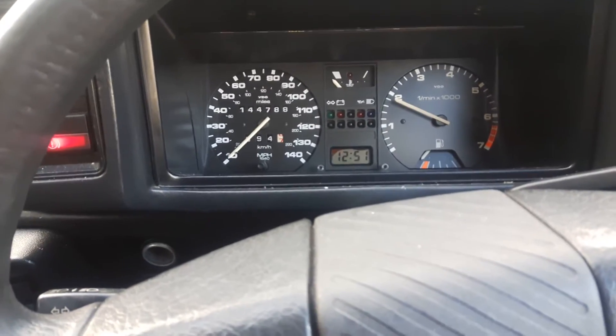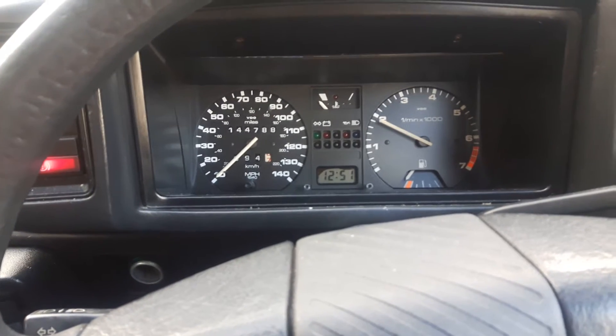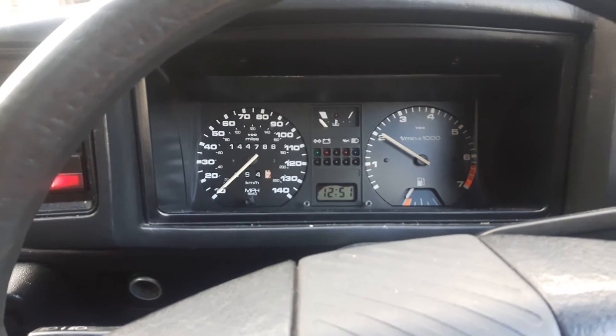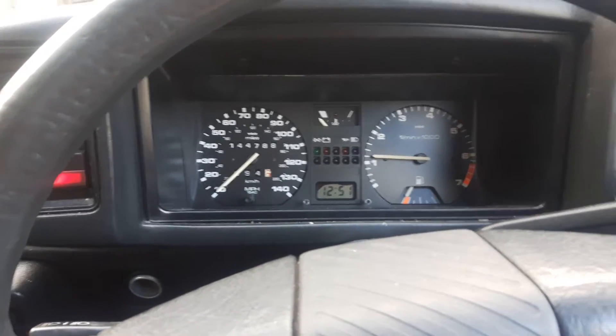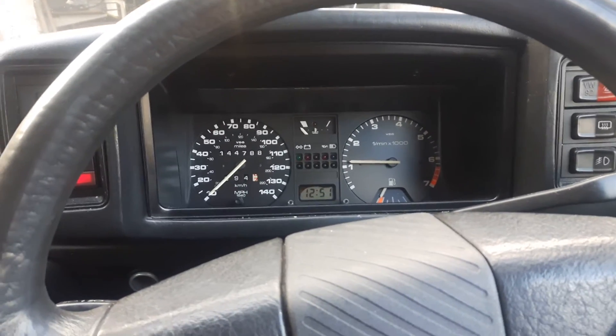There we go — she'll pick up in a minute as the drag decreases in the oil, up to about 2,000 RPM. Now she should drop down depending on how cold it is. There you go — you've got your defined drop to 1,200 RPM. That's how they should work, and then after that point it gradually goes down to your preset idle speed.